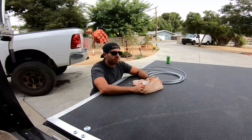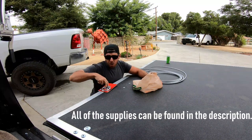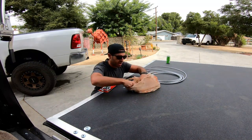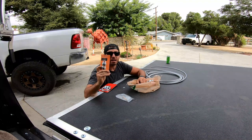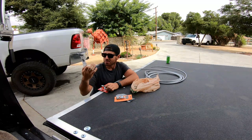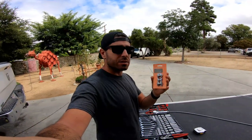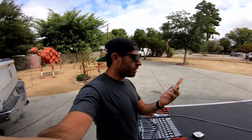Alright, here's the game plan. I'm going to attach some of these heavy-duty D-rings. I'm going to bolt all the way through the aluminum — it's aluminum on two sides — and sandwich it through with some grade 8 hardware. Then we're going to use these little cable ties at the top and at the bottom, and then at the bottom to connect, I'm going to use one of these quick links. First thing I'm going to do is attach the cable on the upper side using these wire rope clips for securing cable with a looped end. We're going to attach the cable at the top first.